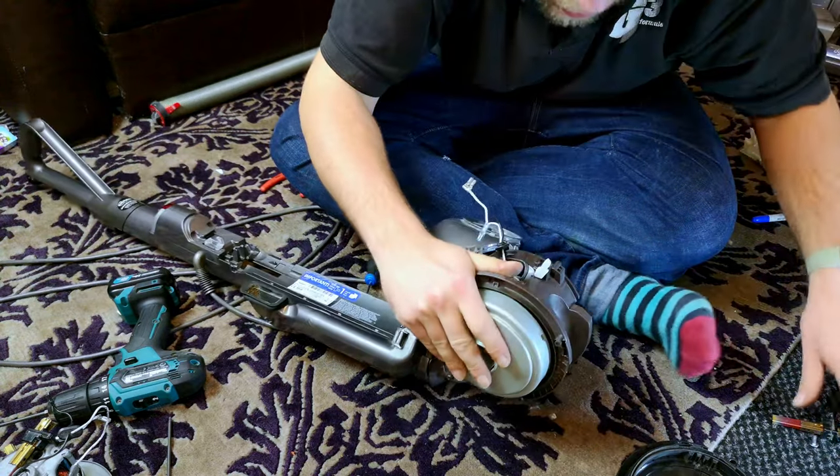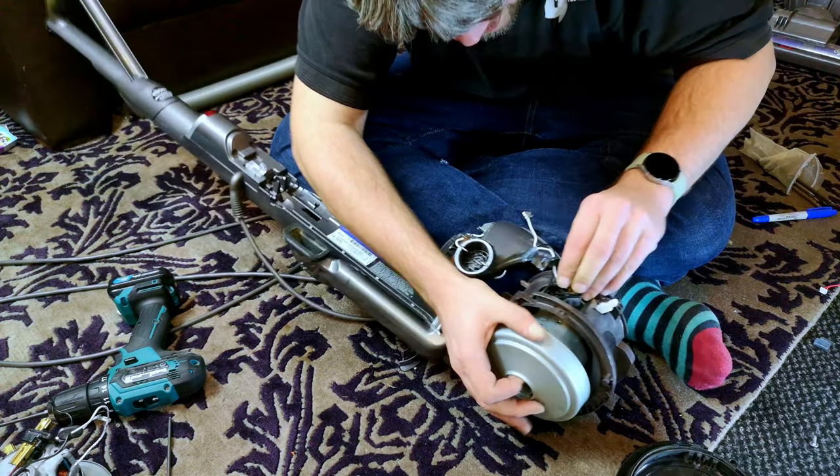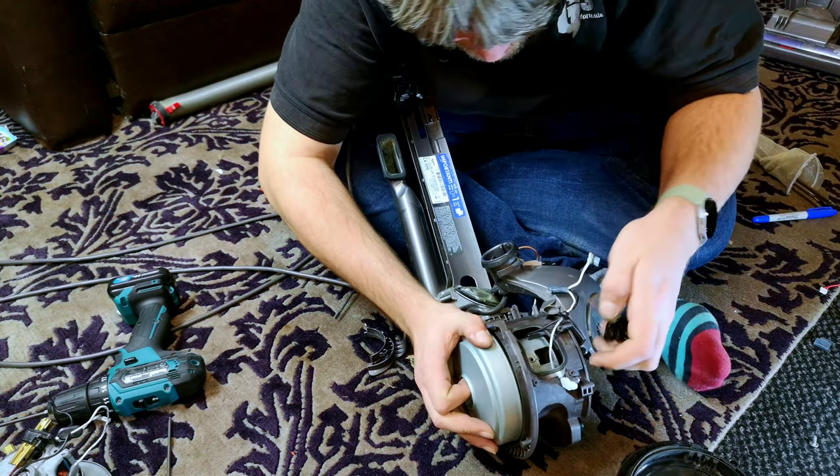Here is our dodgy bearings motor, and here is our good motor. You can see I wrote on the fan case - wouldn't it be hilarious if we put the bad motor back in! Out with this one's carbon brush - I'd already left it loose from doing it the first time. The carbon has already started going a bit grotty so it's not worth keeping. I just never get why people think you can change the carbons on the Dyson - I'm afraid you can't, unless you're incredibly lucky. I'd rather just spend the £15 on eBay whenever you need to do this.